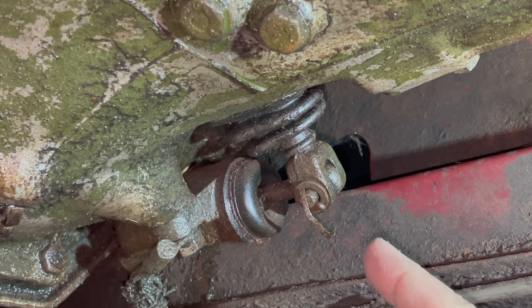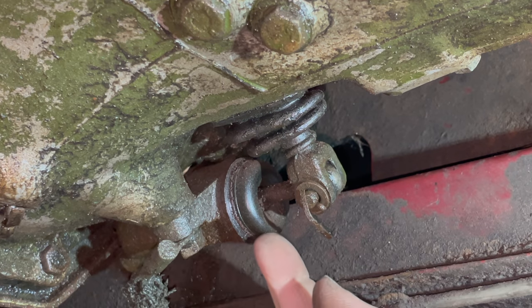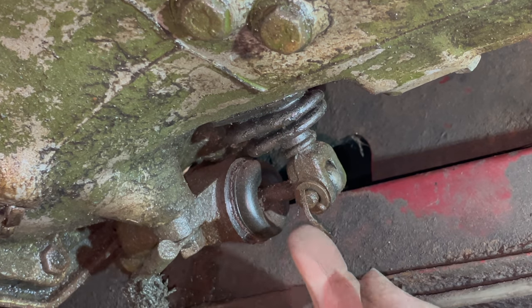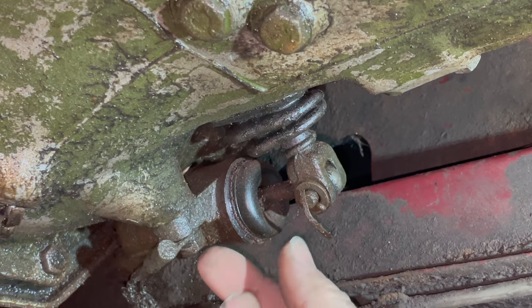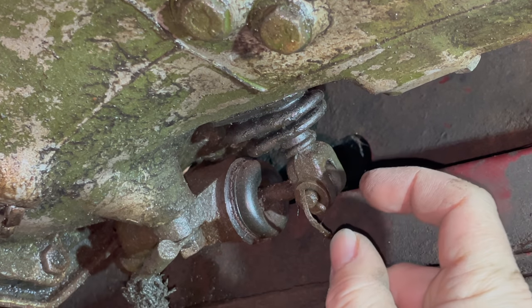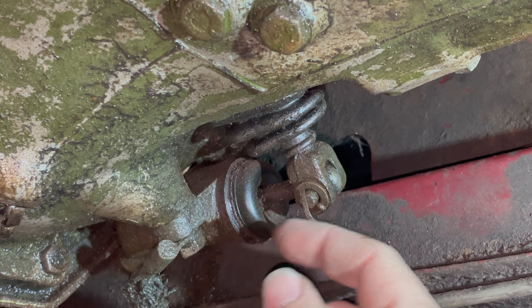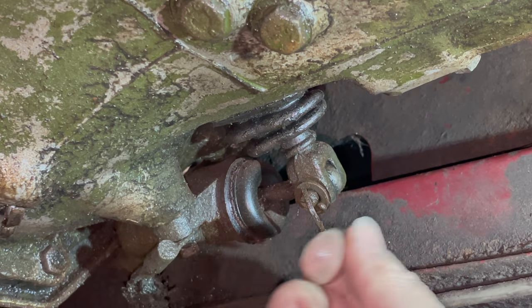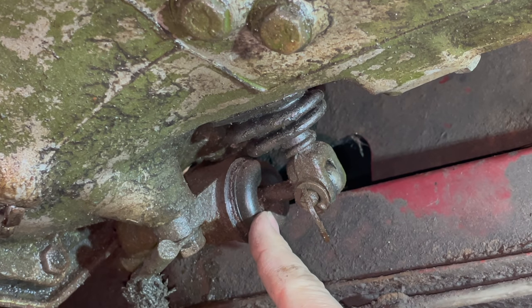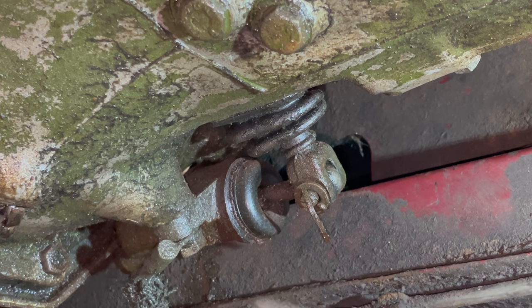Okay, I think that was working. It first felt like it was getting hung up. What happened is the piston was pushed forward, but since it hadn't been moved in so long it got stuck in the out position. As I applied more pressure it moved a little bit more, and that small movement was enough to free it and allow it to retract. Once it moved forward and back one time it was freed up with smooth, easy motion in and out. This slave cylinder is going to work — if I wanted more reliability I could pull it off and put in a cheap rebuild kit for just a couple of dollars.